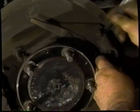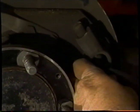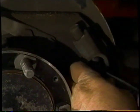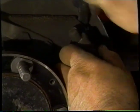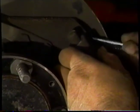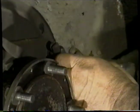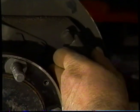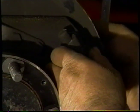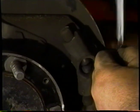It's another tight location, and what we're going to do is use a thin wrench and work both of the bolts. This allows the adjuster to come towards you and allows you to keep using the box-end wrench on the bolt. To try and use the open-end wrench, they're too fat, they don't allow you to do this. On the back side of these, of course, there's the adjusting handle, which we'll have to undo the lock nut and then unscrew the handle off the shaft. And before we get too far, we'll undo the lock nut. And then we'll undo the handle.